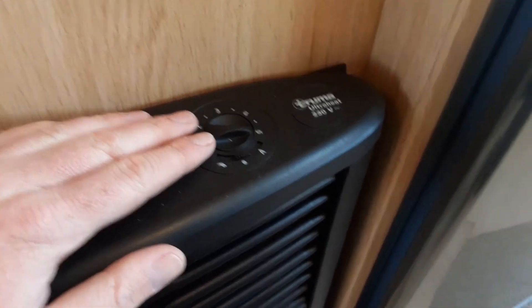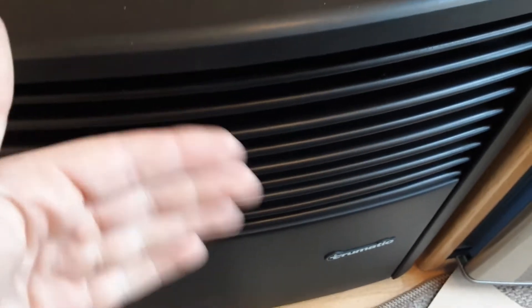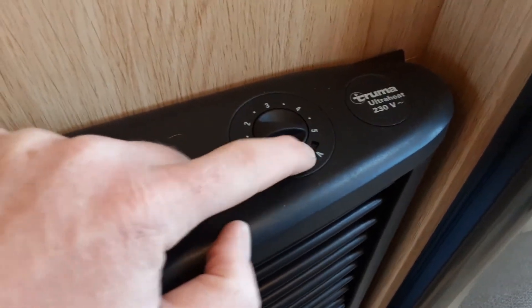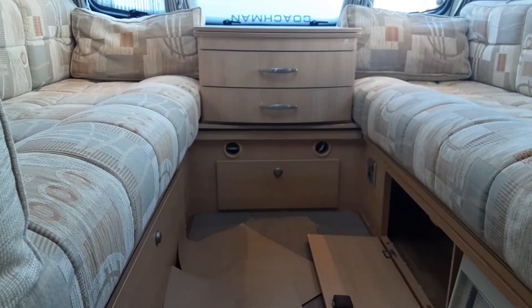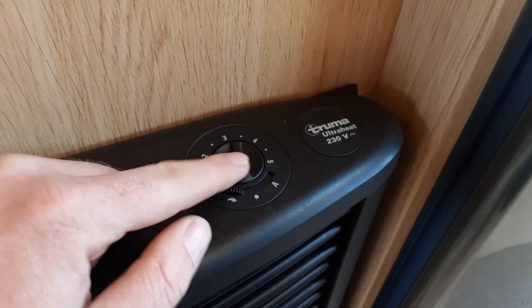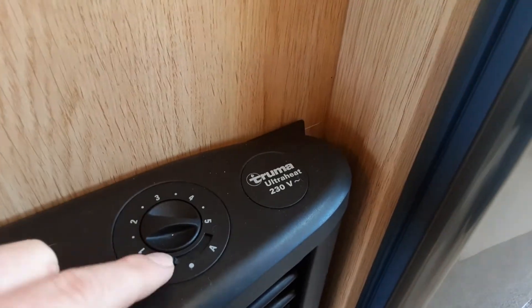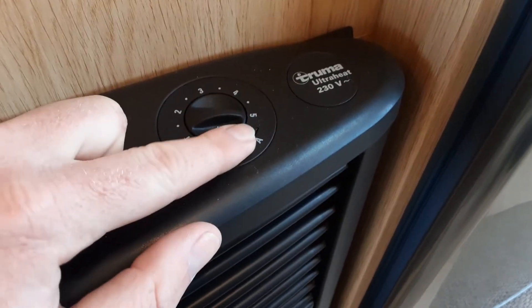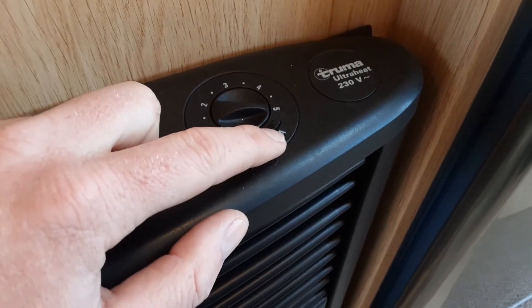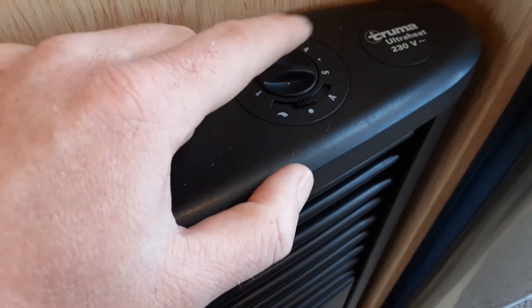On the right-hand side top of the heater you've got your blown air heating option. The dot in the centre indicates heat coming out the front of the heater. The wave symbols on the left indicate blown air, where heat comes out through vents around the caravan — similar to heating in a car. You can use the fan speed control on top to adjust the amount of air blown around the caravan. Selecting A on the right is automatic blown air, where the heater cuts in and out via the thermostat.